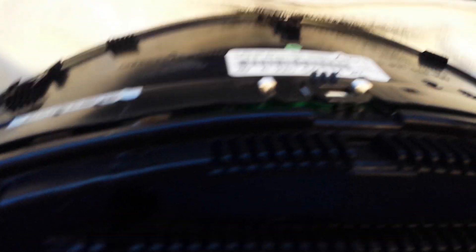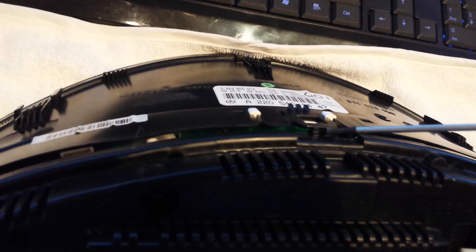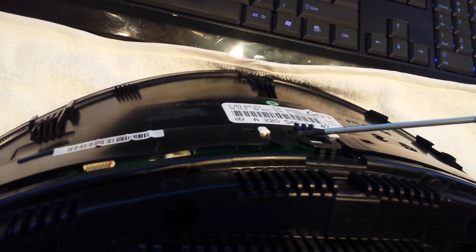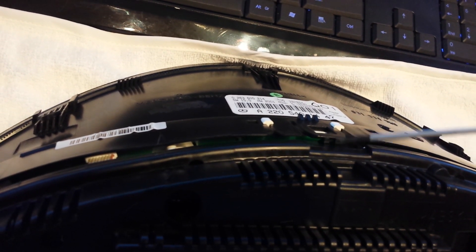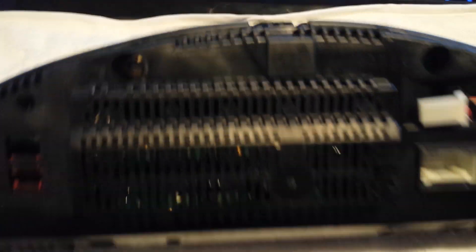Once you open the screws, gently pry on the tabs at the top — there are tabs all around — so you have to lift the tabs and push the back panel back. Be very careful because many of these models are now old and the plastic can crack if you apply too much force. If the catch isn't releasing easily, use a hairdryer with gentle heat on the edges to help lift and open the back panel.